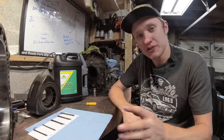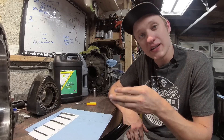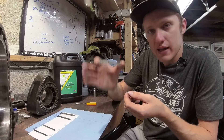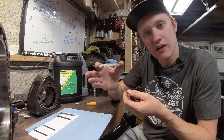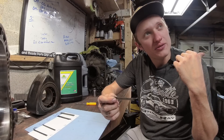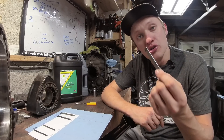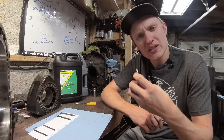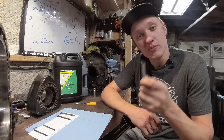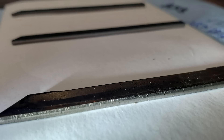Both of these seals' composition, because they are factory OEM Mazda seals, are much softer than the next two seals we're going to look at. This seal is an iRotary apex seal that came out of an FD RX-7. This was the engine in the Black car probably two years ago — a half-bridge port engine with used housings but new iRotary apex seals. The housings weren't resurfaced before it got built, as this engine was built before we got our resurfacing tool. I would rate this about a 7 out of 10.